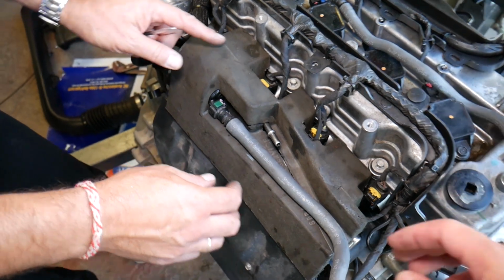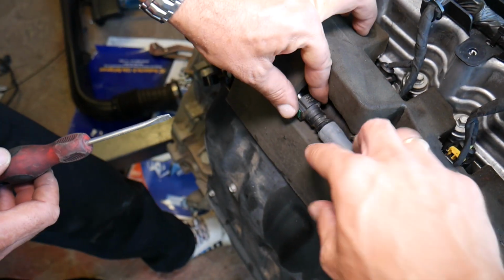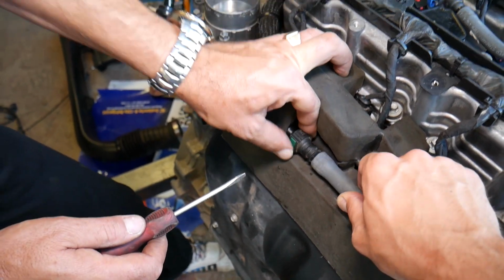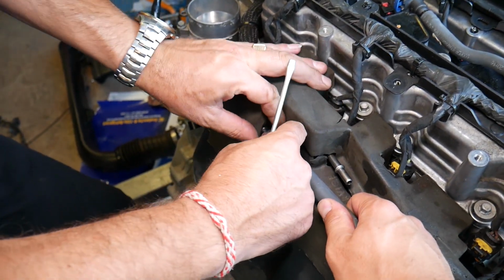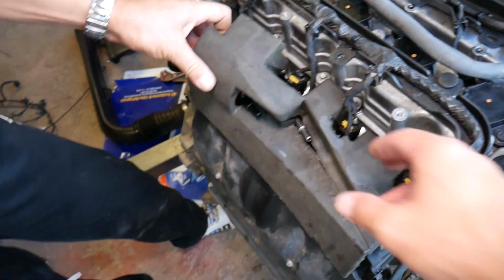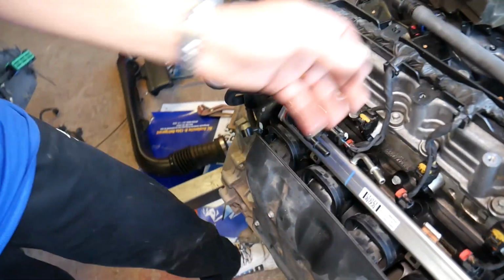This is out. This hose right here for the purge valve, we have 2 green spots. You need to squish those towards each other and pull it out. It got stuck. No, again, it's stuck. So we need to push with the screwdriver on one side or really hard with your fingers. Great. That foam piece, be careful, pull it gently out before you break it.